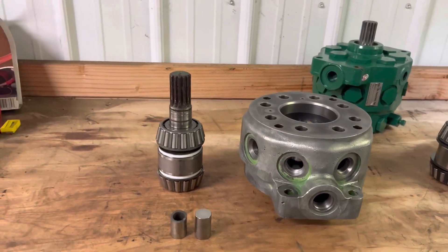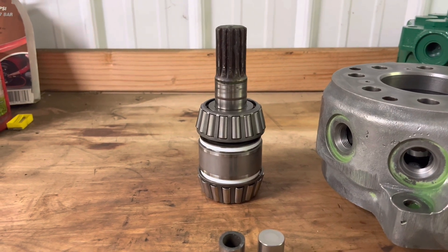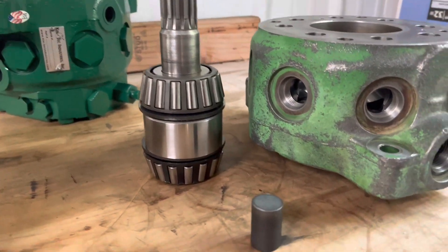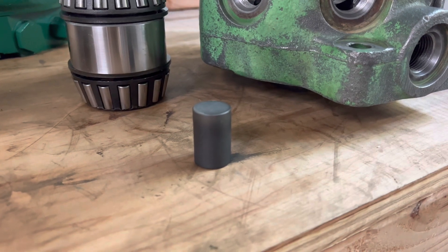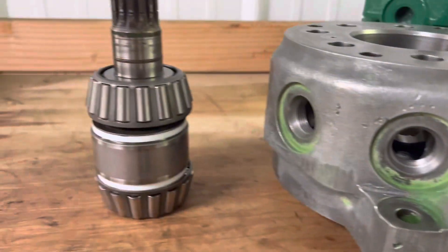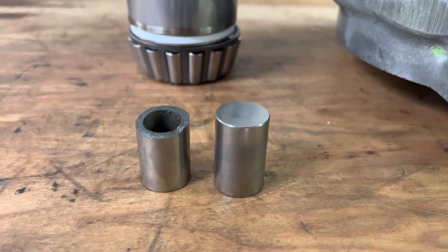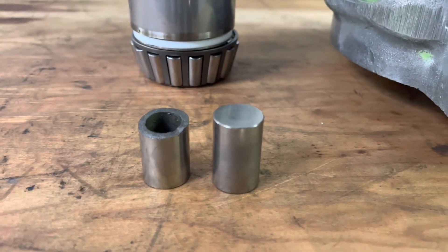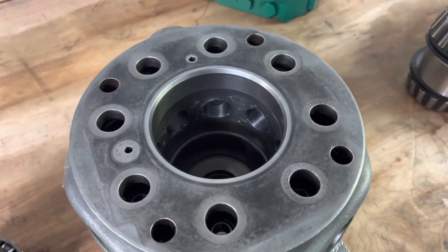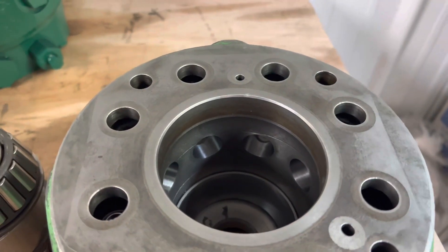The big things are the parts internally. As you can see, the shaft components have some type of neoprene thrust washer versus the OEM metal. And then the pistons — we use all-steel heat-treated and then we do manganese phosphate coating on our pistons, versus not sure what these are made out of, but you can see what happens to them in no time. A lot of it is the heat treating done overseas. And then also inside the housing, you can see these get scuffed up pretty easily versus an OEM one, which is in good shape.